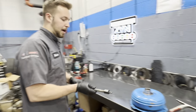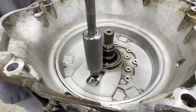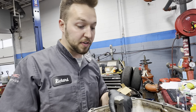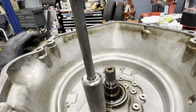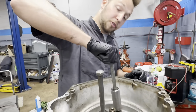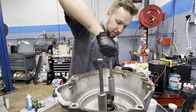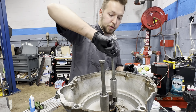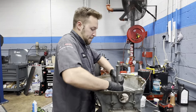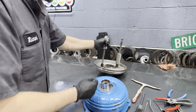We're going to get our slide hammers and install one of them right here — it'll thread in. I don't know the thread size off the top of my head; I just know I bought these from an old man who used them for four-speeds and two-speeds, and they work. Whatever threads old slide hammers are for most four-speed transmissions, it's probably this — but they seem to work well on the 8-speeds. So this is the automatic case front cover, and the front cover is off.